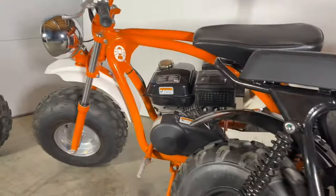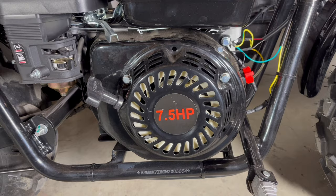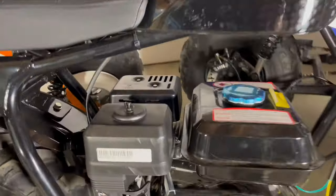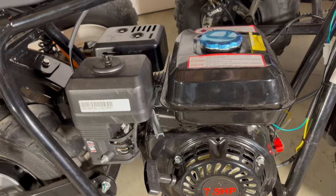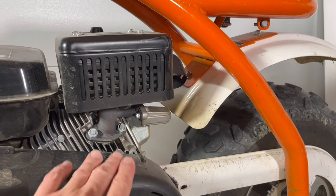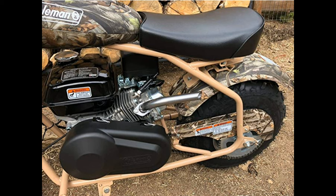These all have 6.5 horsepower engines, including this one, according to the Massimo website, but Walmart put on this silly sticker. There are a few modifications you can do to get more power. The first is to take out this throttle lock screw here, which allows your twist handle to give you a wide-open throttle. This video shows you how. Another is to unbolt the stock muffler here and put on a straight pipe — it looks like this, gives you a little more power, but is definitely noisy.